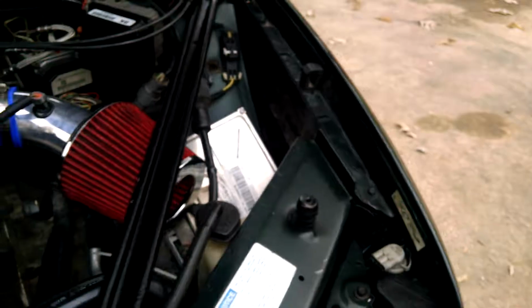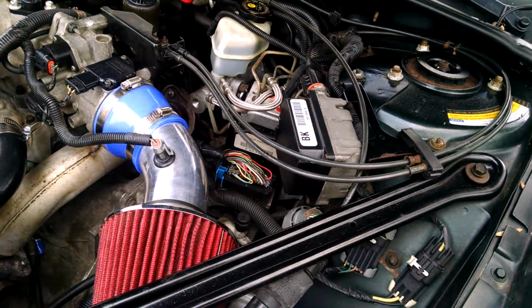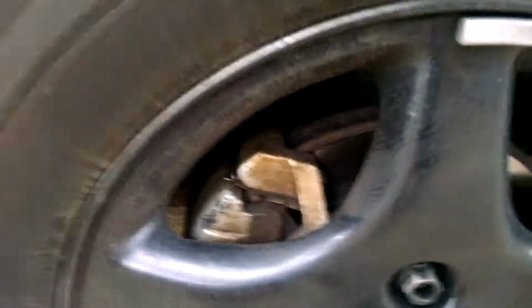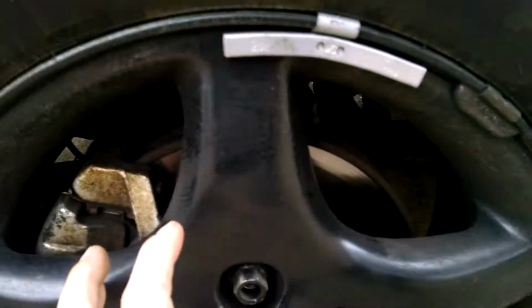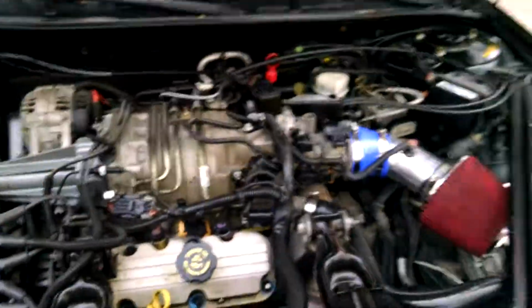The ABS will also cause your ABS light to come on and your traction control to not turn on. Usually, if you put a scanner to it, it'll tell you which wheel, but a lot of times it is the wheel hub, which holds the caliper and holds the rotor in place. A lot of times it's the wiring to that. I've replaced the wiring on mine, rewiring using the old plug-ins, and that wasn't the problem, so it's actually in the hub that breaks. That's it.